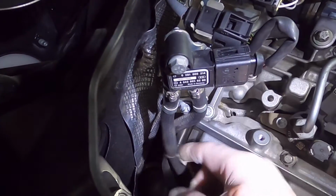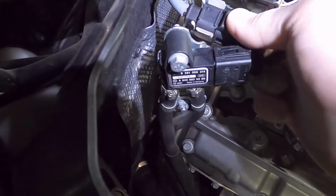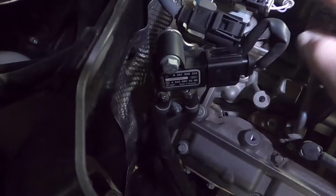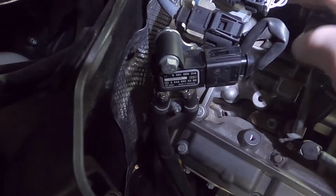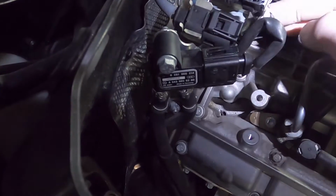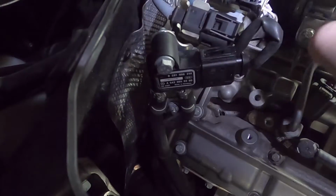Just crimping on those hoses. Okay, so we put these connectors on, clip this one down in the bracket, push this one onto the clip, check the routing of my new sensor wire. Looks like it would love to be clipped to that, but maybe we can just go under that. Okay, we've got the hose on, and we're ready to put the air cleaner back in.